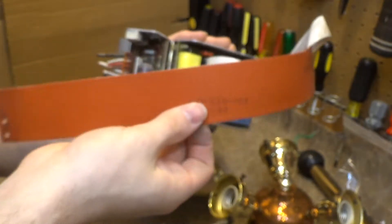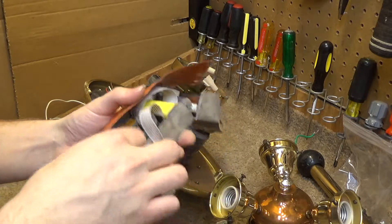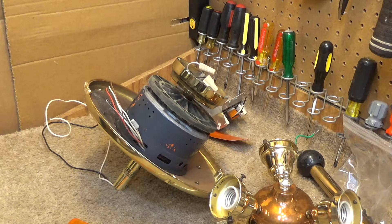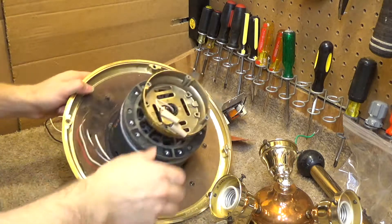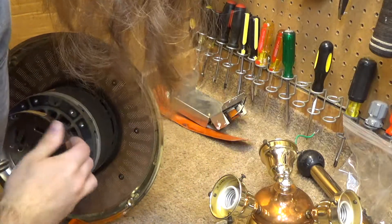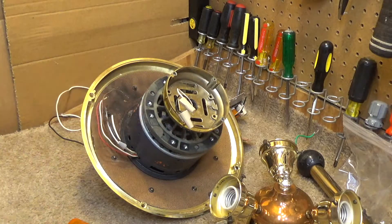So I think it's safe to say this board is spoiled. I'm not going to toss it — I'll hold onto it in case maybe it's not, and it's probably repairable if it is. But I'm definitely not going to use it, and we're going to have to convert this fan to a pull chain control. At this point I just need to get the switch housing off, which looks like it's probably simple. I think it's just a little Allen key that holds it on, then the flywheel, and then we'll have to split the motor open.